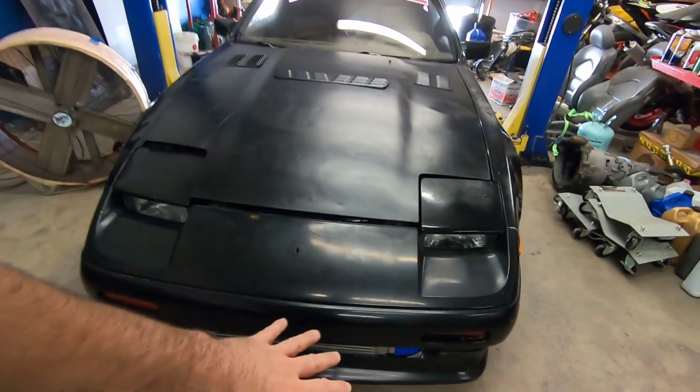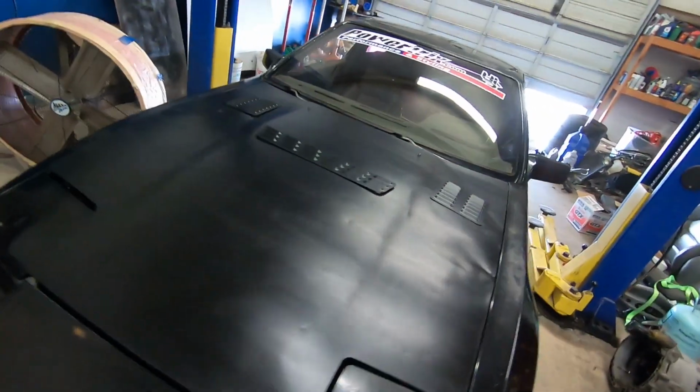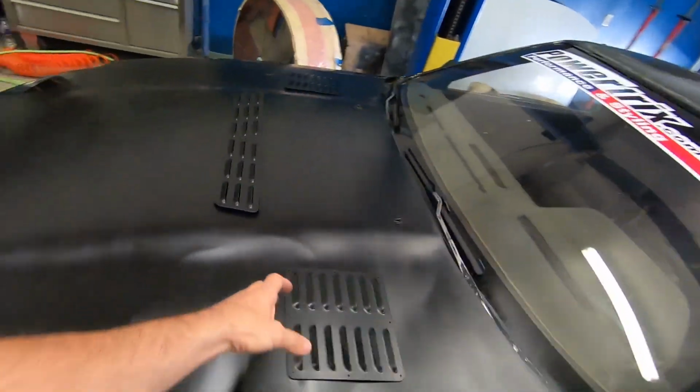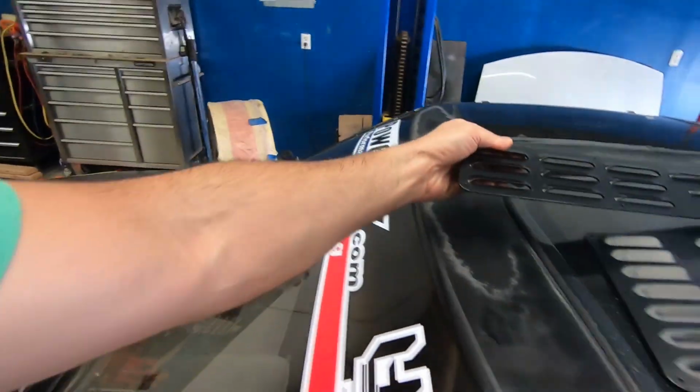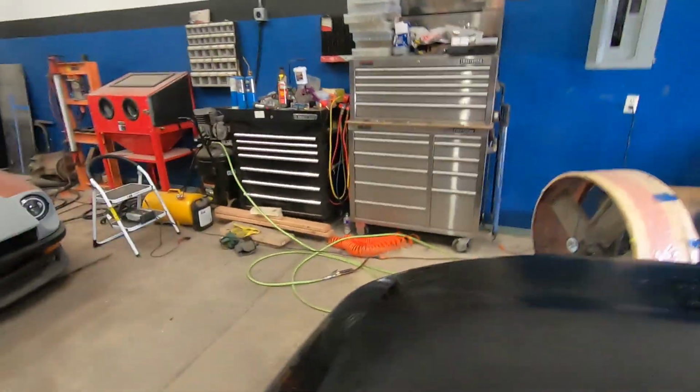We're going to put the hood vents in and we're going to re-gap the plugs, and hopefully after that, that'll take care of that cutout that I was having, and also this will help aid in the cooling of the radiator, getting that air to pull across the custom ducting that I did to find its way across the radiator, because the radiator is vertical mounted and it's going to need all the help it can get, honestly. So hopefully that will work out just fine.